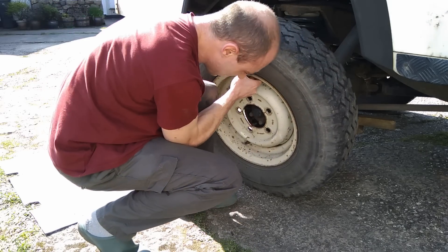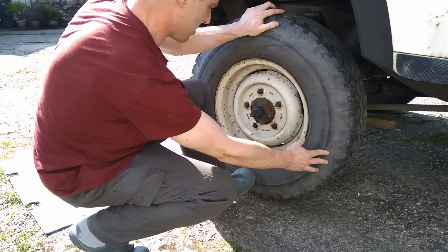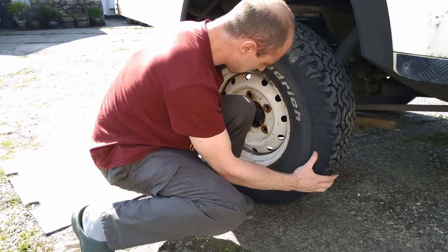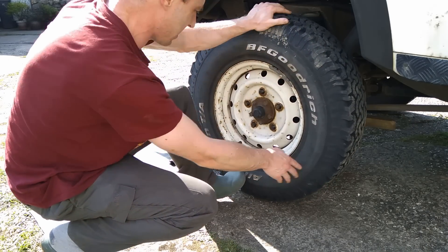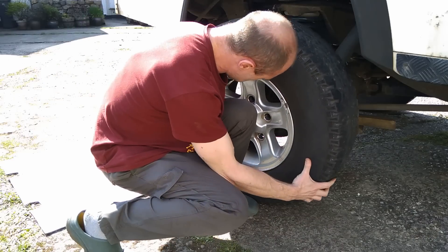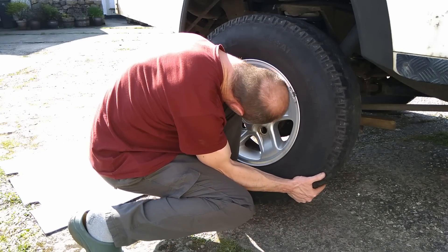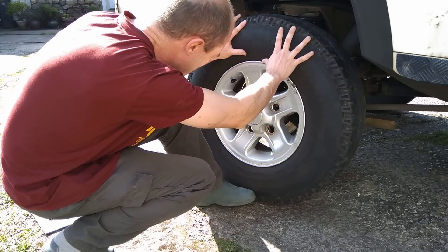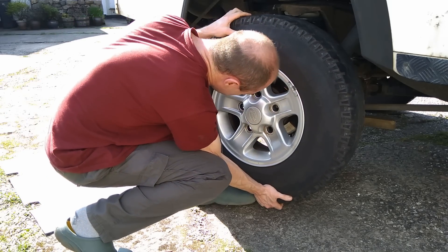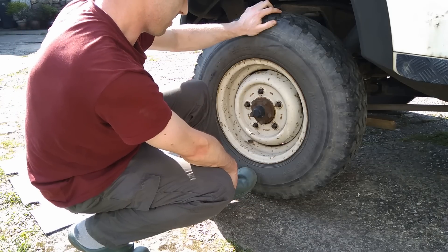In terms of fitting the wheels to the vehicle, the steel wheel is actually a lot easier - it's so much lighter, and you really feel it with the Wolf wheel. The Wolf wheel is a bit of a bugger to put on. The Boost alloys are also a bit tricky because they don't centralise on the wheel nuts, so you've got to lift it up over the drive member while you put the nuts in. If you're thinking of ease of changing wheels on an overland journey, I would go with the steel wheels.